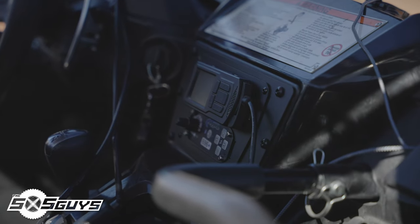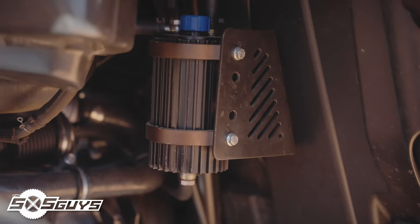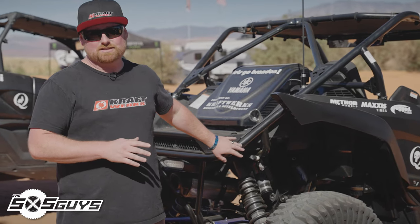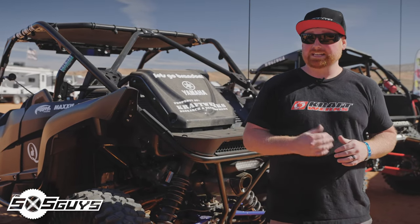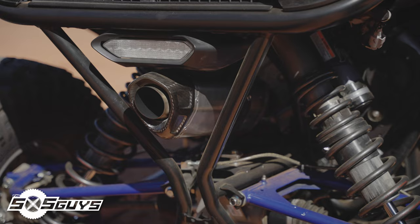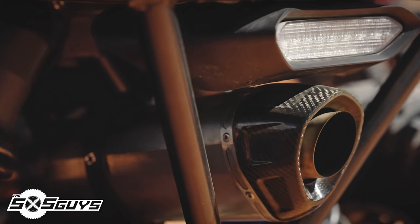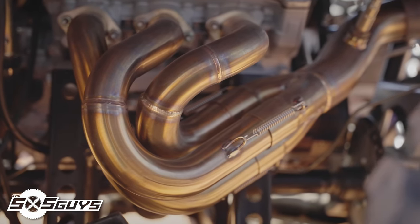For the 2016–2018 at 5 psi — safe on the rods — you're looking at right around 120 wheel horsepower. With the added two to three pounds of boost on the 2019-plus kit, you're looking at about 140. We've also been getting customers sneak peeks at our new exhaust for the YXZ. Our race exhausts are coming out very soon — there's nothing else like it on the market.